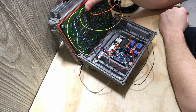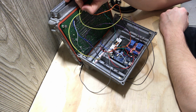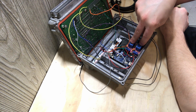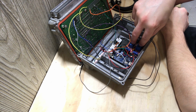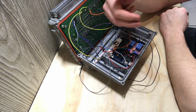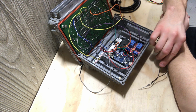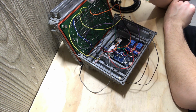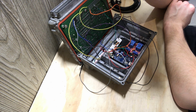And it would be interesting to not cut it, but interrupt the signal coming back on low using the Arduino. I have relays here. The relays will probably be fast enough, but they're going to be hard on the relay itself, the fact that it's an actual mechanical switch that's turning that off and on. So I have a random box of transistors. I don't know if that'll do it. I might have to use a MOSFET again.